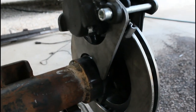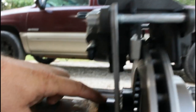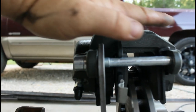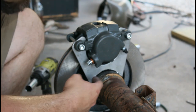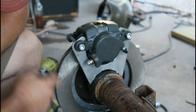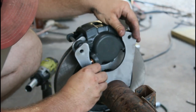I'm cutting this part here because I need to close this distance. If you look at the brake pads, they're only barely pinching the rotor, so it needs to sit further down. I'm cutting this out so the caliper will sit down lower. In the past I've had problems with them clearing 15-inch wheels if you leave them too high. You also want the brake pad to pinch the middle section of the rotor. So we got the brackets cut down and ground down — it took a little fitment work. What you're looking for is that your pads are engaging fully on the rotor, and you don't want it so low it's hitting the hat on your rotor. For reference, this is where the stock ones sit.